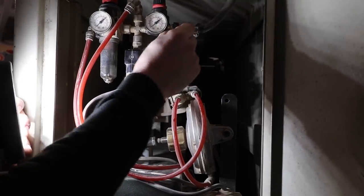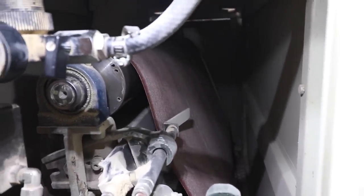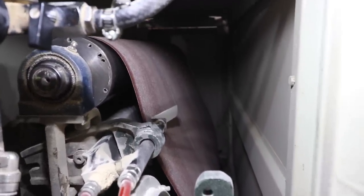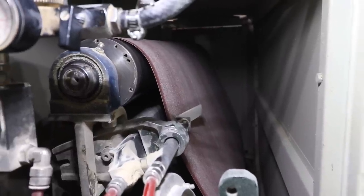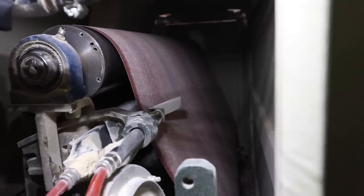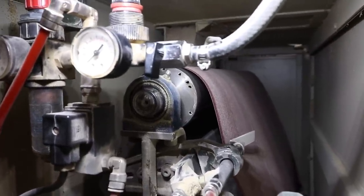Other than that there's not really a lot going on this end — you literally open the door to turn the air on and off. One thing I did early on: I wrecked a few belts. When putting the belts on, the fold in the belt where it sat in the box would sometimes loop around the outside of the little bar in the center. You wouldn't notice it putting the belt on from the other side — start it up and it ripped half the belt off. Just watch out for that one.